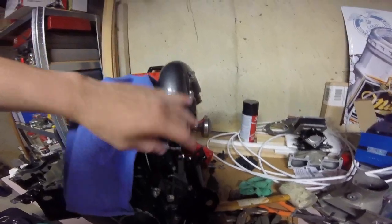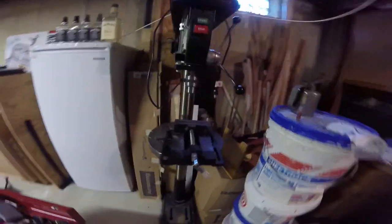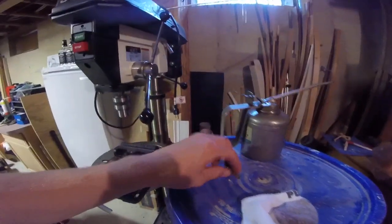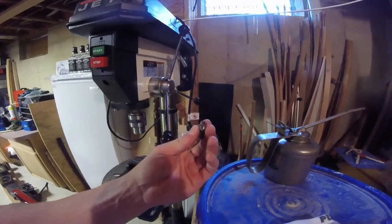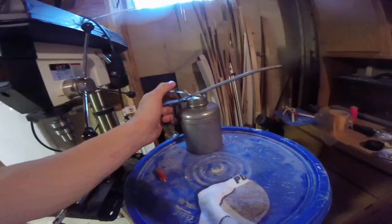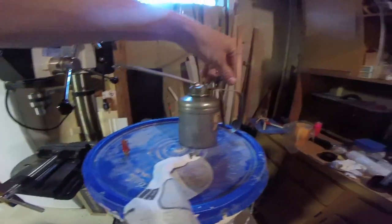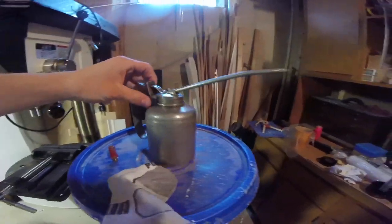Do the fitting at the manifold, then just follow that cooling line around and drill them all out — you will get better cooling. Your engine will love you for it. It also helps if you use some drilling lubricant or cutting oil while you drill.